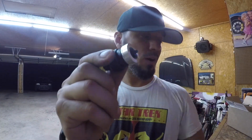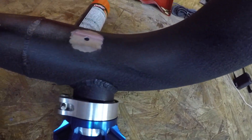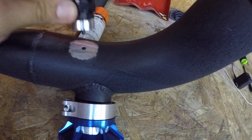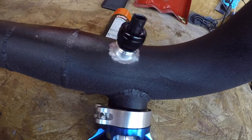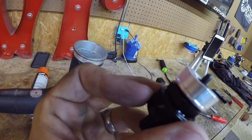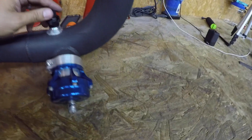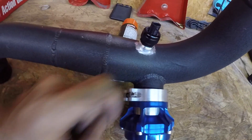What we're going to have to do is weld this with the charge pipe. I went ahead and took the charge pipe — we're going to take this out so I can show what I'm talking about. That's kind of how it's going to go. I made a hole right there — you can tell where the sensor goes, for the little nipple — and it's going to go right there. We're going to weld it right there and then paint it after that. What I did here is I shaved a little bit on two sides so it can be more flush. It's a little bit more flush right there, so when you weld it you don't have a lot of gap to build in.